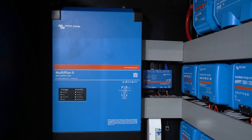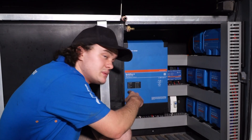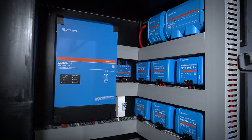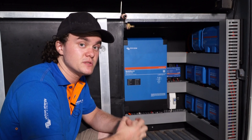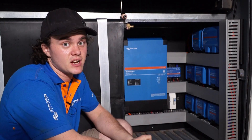A big part of this system is the 5kVA inverter — it's a MultiPlus 2 from Victron. This fella is going to be responsible for running all the AC loads around the coach as well as charging that big battery system. It's a 48-volt 330Ah battery system with a 70-amp charger that can really punch the power in if it needs to be charged off 240. Unlike a typical caravan governed by a 16-amp inlet, we've run a heavier cable to a dedicated subboard with separate circuits, allowing the customer to use more than 16 amps at once — he's actually got more power off the grid than most caravans have.